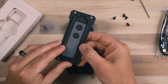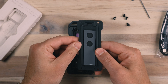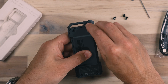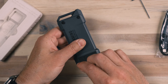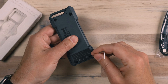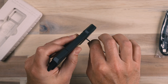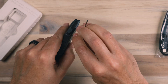On the backside there is some thermal tape that has already been peeled — it's sticky and ready to seat on the NVMe to help with heat dissipation. Now put the backing back on the enclosure and put the screws back in. This enclosure is built really well. With cheaper enclosures you want to be careful not to over-tighten the screws as they can strip out rather easily. Even on this one you don't want to over-tighten — get them finger tight first, then use the wrench to tighten a bit more.